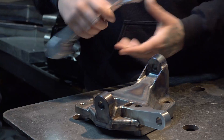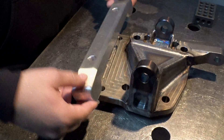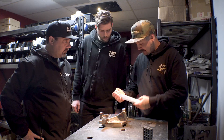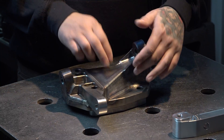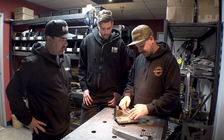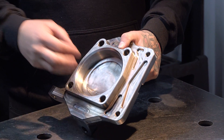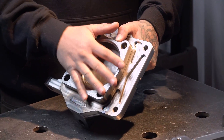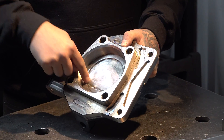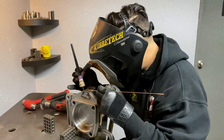It's got this little keyway — it helps register it in there. So it registers in there like that. Obviously the bolts will hold it in, and this just helps keep it from wanting to twist from the torque of the braking. The caliper is massive. These three pieces here are chromoly plate — pretty tricky because there's a lot of material thickness difference. Like welding this eighth-inch plate to one-inch plate, all double passed. And then pretty tricky to weld the steering arm piece because the middle of the spindle there is about 20 thousandths thick. We had to machine that out because the unit bearing stuck out a little far right there and obviously we didn't want it to rub on the back. So we machined that out and it only left us super thin.